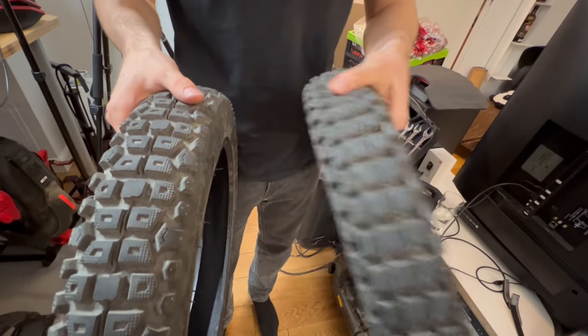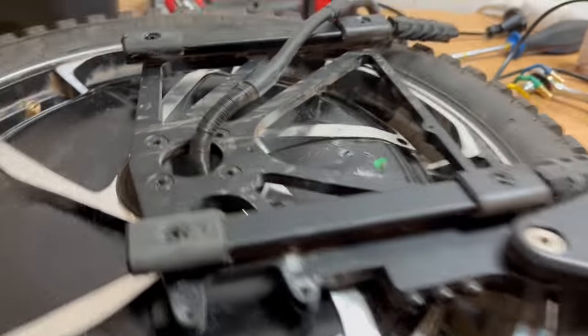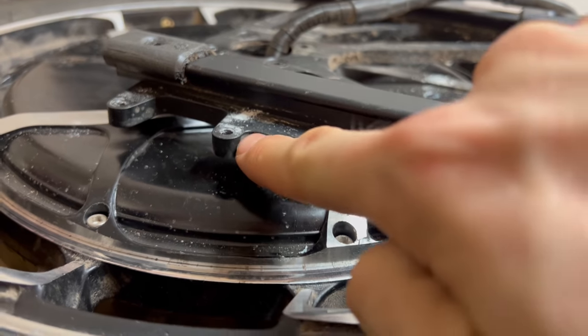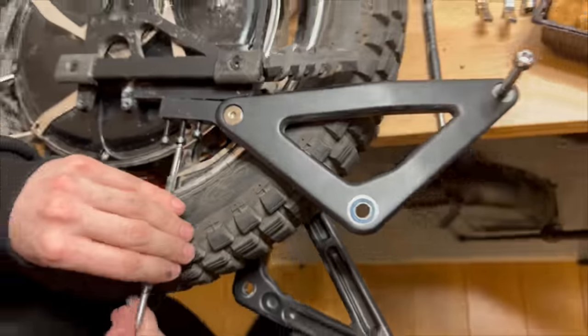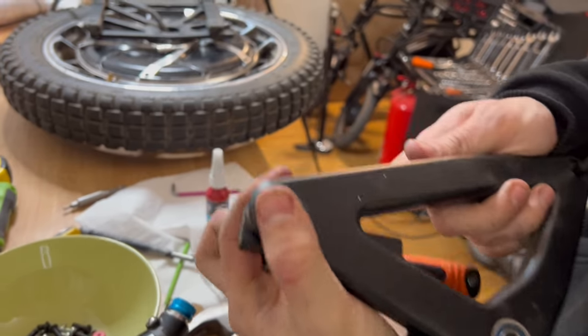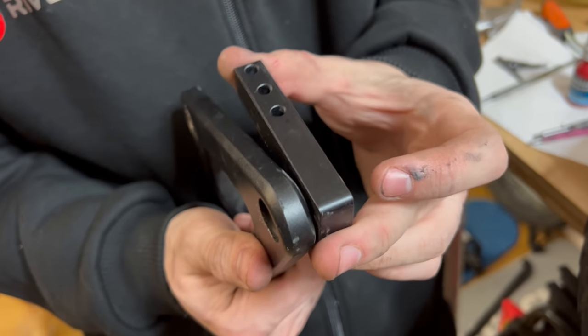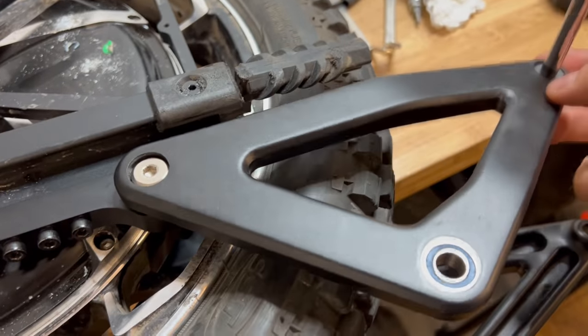The replacement tire is a lot harder. It's like a similar rim to the Veteran Sherman — looks very beefy. A great aspect of this motor appears to be the weatherproofing of the bearings; I don't think there will be bearing problems even though it's a hollow bore. On the back of the suspension you can see many threads, which is how you can adjust it. We changed it from the top setting to the bottom setting and it's a lot better now. However, the tolerances on the whole suspension mechanism are not great — some bearings are too narrow or there's only a single bearing instead of two. These pieces move around a lot, which is not a good sign for extended riding over several thousand kilometers, as they may get loose and break. They're also aluminium.